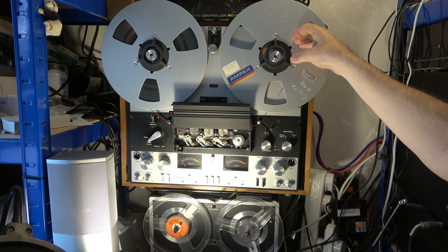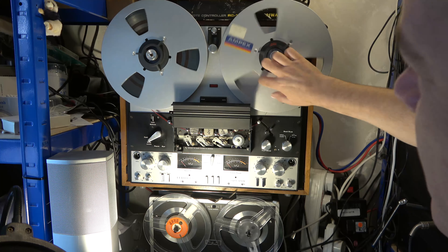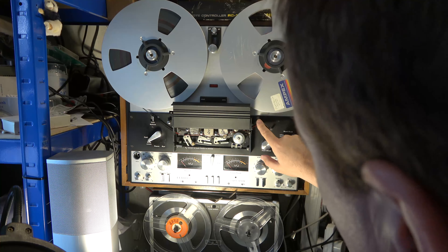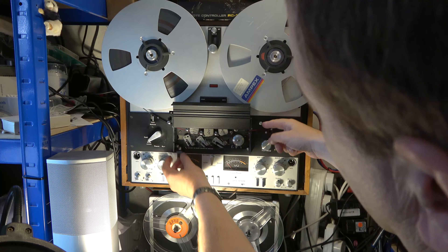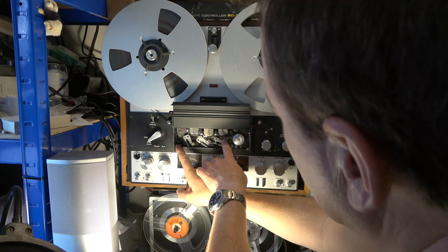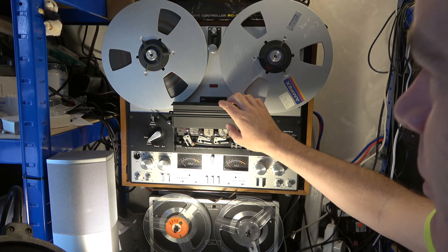People have their own techniques for fitting a tape on a spool. I'm not one who likes big bits of straggly tape everywhere — I hold it against the spool and run it like that. Put the clamps on — this activates this lever here. When it's backed off it's held up, and when you release it the auto-stop and output guide moves into position. It also engages these felt pads, which do a great job of providing good head-to-tape contact. That's ready to play the tape — close the hatch.